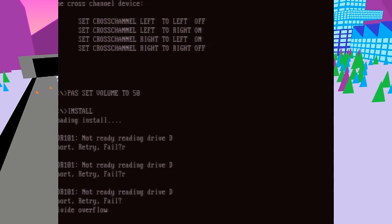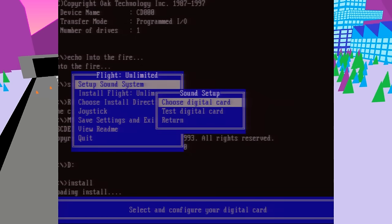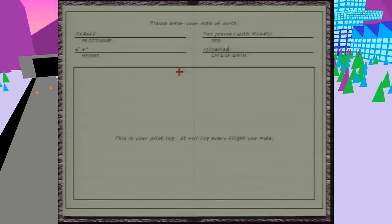Flight Unlimited. There's the divide overflow I love so much. But I caused that one with the mouse driver, and this board's fairly consistent, even when it doesn't work with something, which makes it much easier to figure out. I can actually reproduce this problem on demand. So it is loading a mouse driver into high memory will crash Flight Unlimited's installer on this machine.